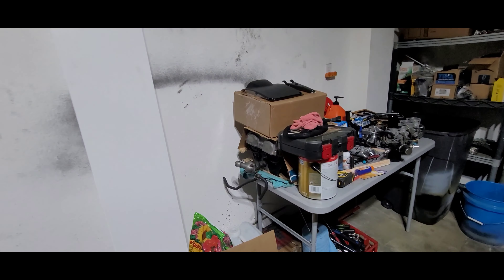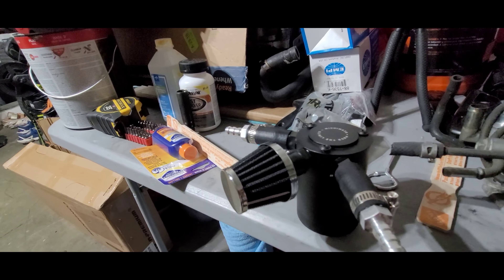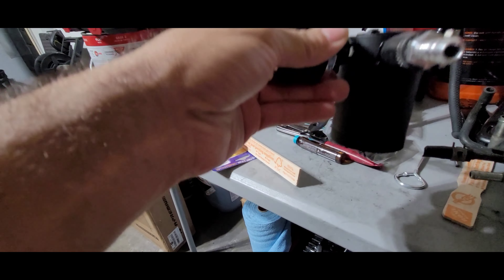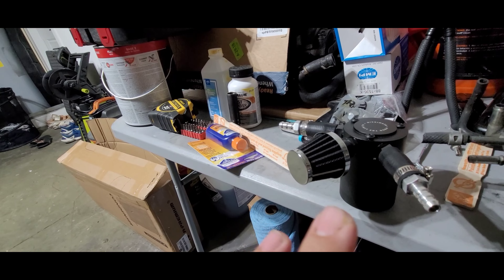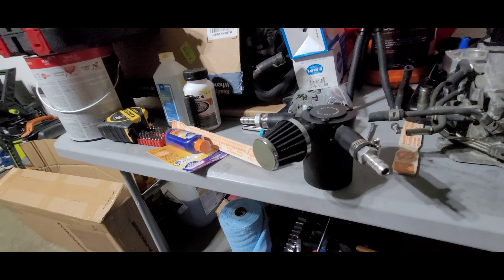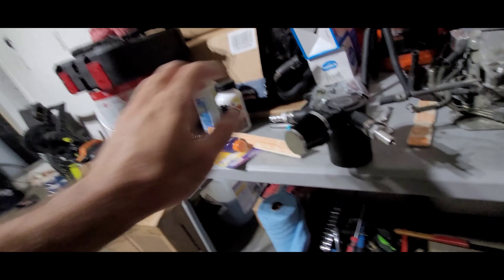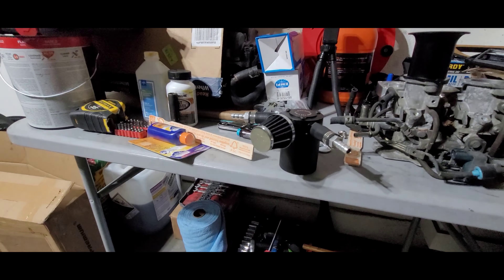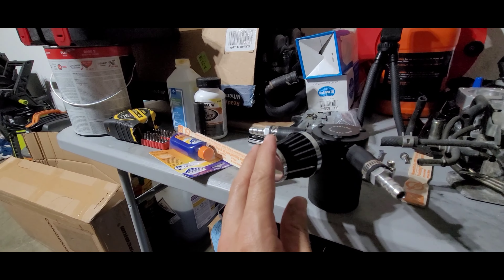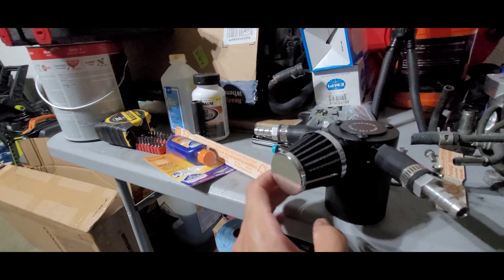I've got the BBT motor and my BP4W, so we're going to frankenstein those two together for the ITB build. Mishimoto has two-port and three-port versions, and a smaller and a larger unit. This one is baffled, so it helps separate the oil that comes out of the valve cover from the PCV side of the valve cover — that way it doesn't get mixed in with oil going into the intake. The purpose is to reduce oil inside and also help relieve pressure, especially useful in turbo applications.